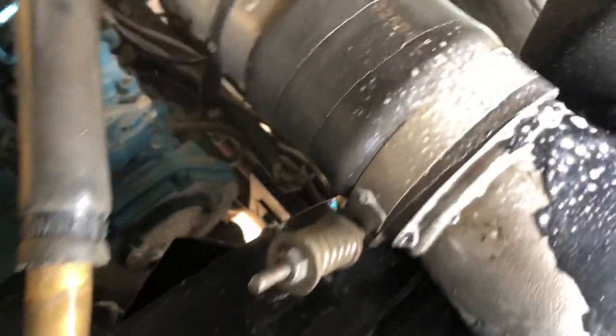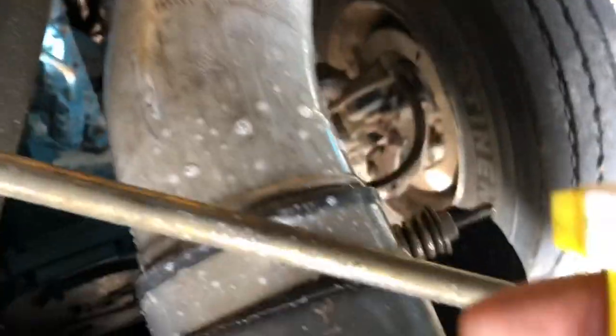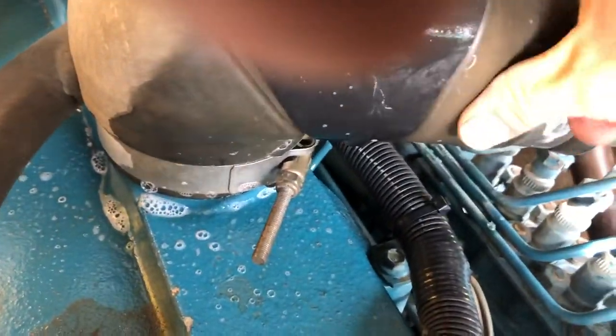The inlet boot is obviously leaking pretty good - so there's one. The other side of it is leaking ever so slightly, right there. That one's so big it's not even making bubbles, so that one's leaking. The outside outlet going into the intake - that one's not leaking bad. This one doesn't look like it's doing anything. But this guy - man, no wonder I can hear it. That thing's leaking like crazy.